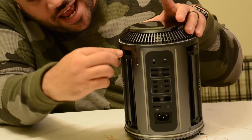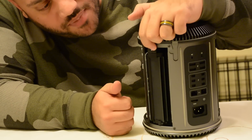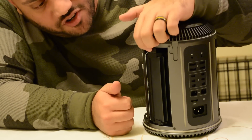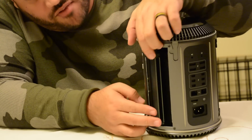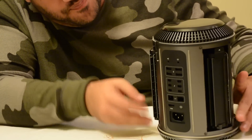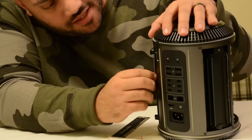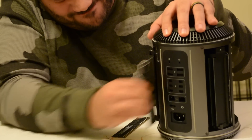I'm going to take out my RAM modules — four 16 gigabyte sticks, which means we're going to have 64 gigabytes packed into this Mac Pro, the maximum it currently supports. To upgrade the RAM, go to where the RAM modules are. There's a little lever right here — you just push it in and the RAM pops out. Then you pull them out like that, and the next one, pull it out.